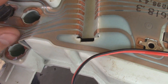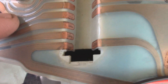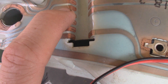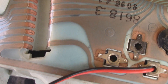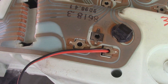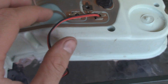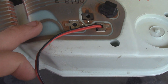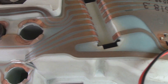So what I could do — and what I have done before — is on here figure out which ones are not used, and then just solder the ground onto a common ground like that, solder that one right there, and then solder the positive to one of these that isn't used, and then wire up that plug connector in there appropriately. That should work, I've done that before. The reason why I'm wiring this into the cluster is so that I don't have wires to try to put connections on to go to the body — because if I need to pull this cluster out for whatever reason, it's all contained.